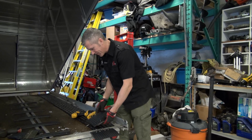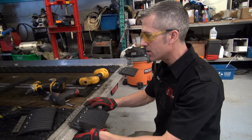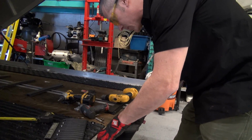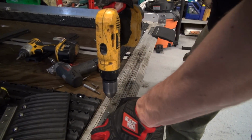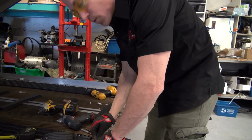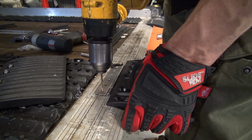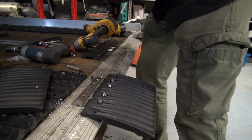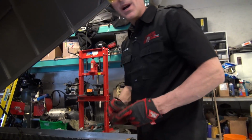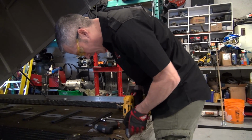We like to make things fit here. Now, this one's sort of offset a little bit. I kind of wanted it like that because of the narrow ski stance on the Elan, to be able to get that up there with no issues. And this one goes right about here. Now I'm not plunging that drill down too deep because there is the wiring for the harness in there. Don't want to wreck that. Putting all these two outer ones into place, then I'll drill the inners. Now I know I'm kind of safe to go in that far because these big long lag bolts just came out of there to make room for that, so we're good.